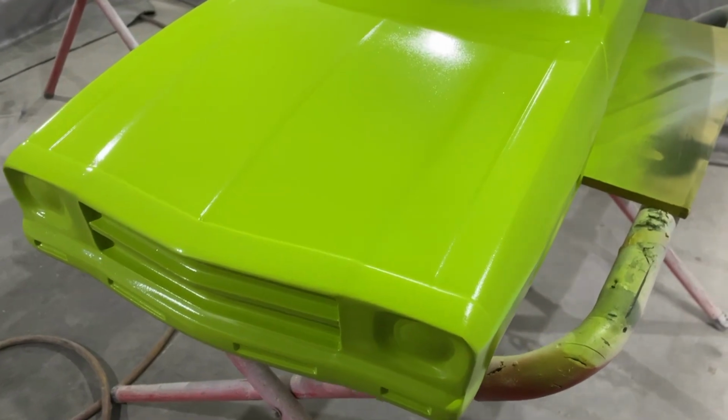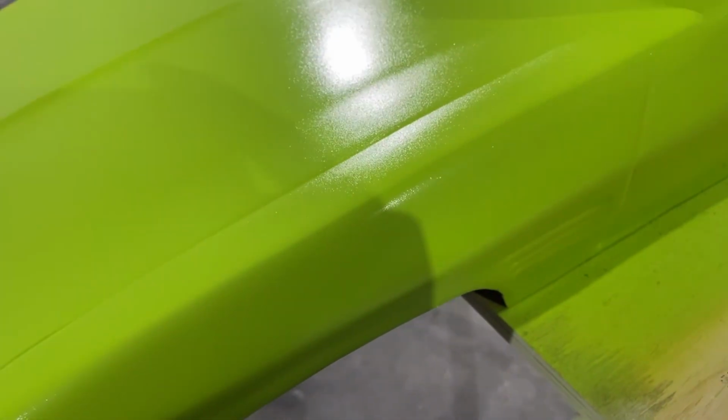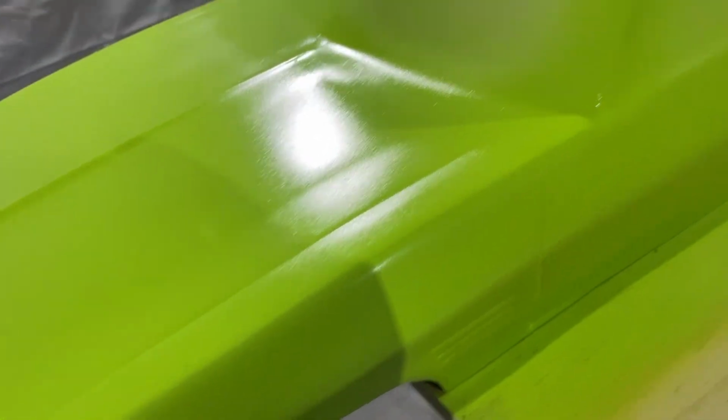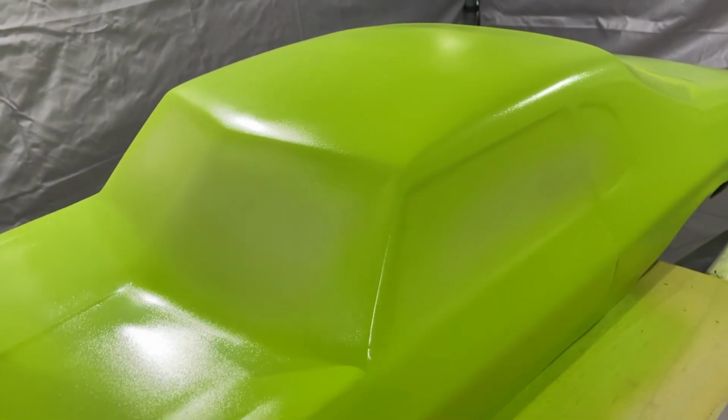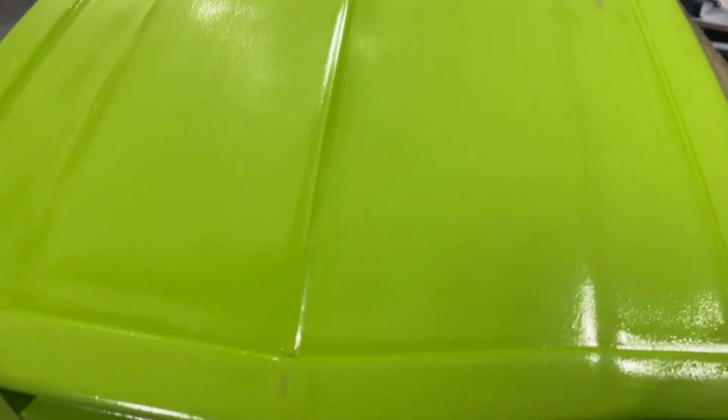It is green, but if you look closely, I didn't put enough thinners in it, so it was drying out before it hit the car. It caught on too late. So, not all is lost. I'm going to rub this back with 800 and make it nice and smooth. Doesn't look much different, but it's much flatter.